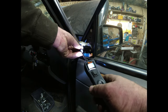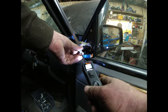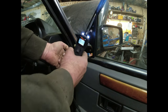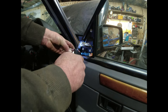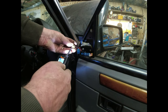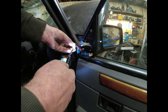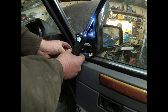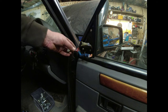Moving to the up position — nothing happens. Moving to the down position, it goes to zero. So I go to the blue plug. Top wire — I get nothing. Top wire again — nothing. Let's keep going round. We've got 4.9 to 4.4 volts on that — couldn't tell you what that is, probably the heater. Nothing on that one. Oh! 11.6 volts. So we'll go horizontally now. That will be the orange and pink wire by the looks of things. I think I said it was orange originally — so the orange and pink wire on the blue connector.